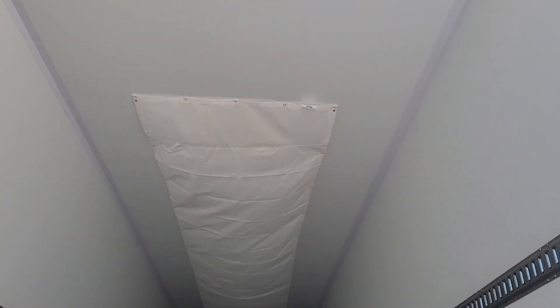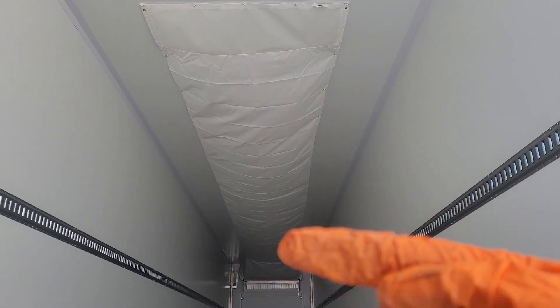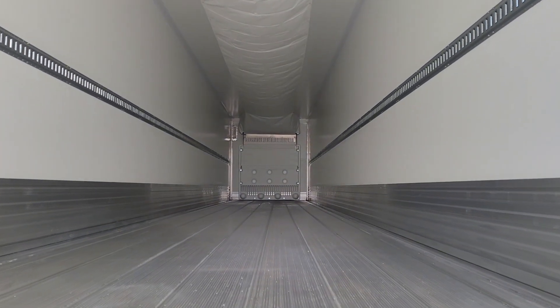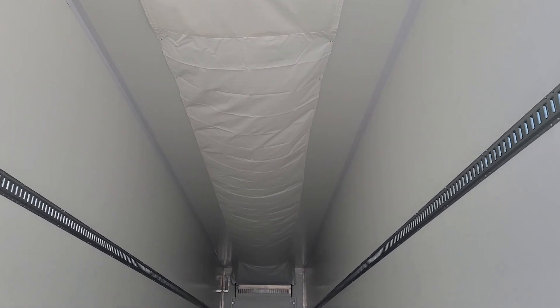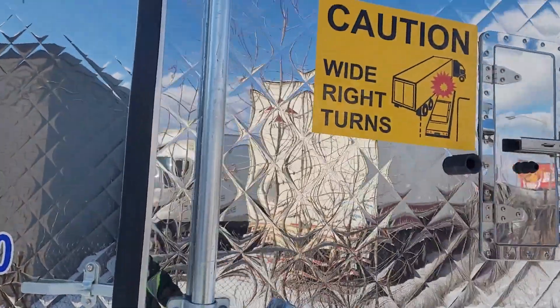Now in the back of the trailer, there's a chute on the ceiling and it should be four to six inches hanging down from the ceiling. Air travels through it, comes down to the floor, and goes through the grooves on the floor which allows it to go under the pallets and come back around in a cycle through the whole trailer — keeping everything at the same cool temperature. It goes right to the back of the bulkhead and comes back up over the chute again.